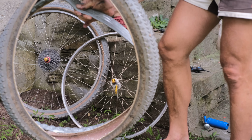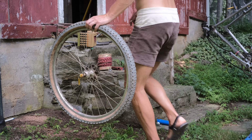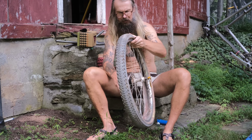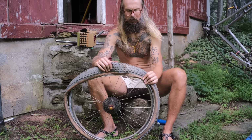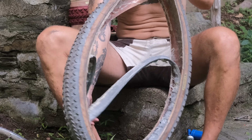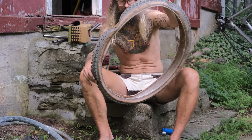This CushCore was put in here like a year and a half ago. This tire probably still had a few months to go on it, if it weren't for the mold. Interesting to note here, folks, I mounted this tire while in Arizona just a few months ago, and there is no sealant left. There's nothing in here. It is bone dry. So this sealant does not last a very long time. It dries up. Who knows if that sealant was still good in that other tire that I just took off, the year and a half old sealant. But this is definitely no good. There's nothing in here. It's just latex. Yeah, I don't know what to say about that. Don't think I'll be redoing these with the brand X. Yeah, it just kind of turns into...